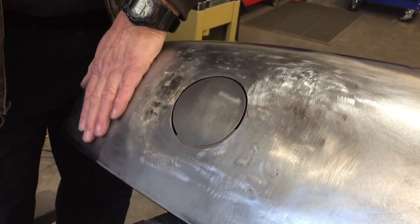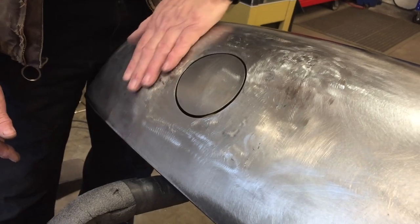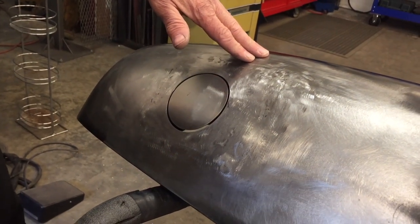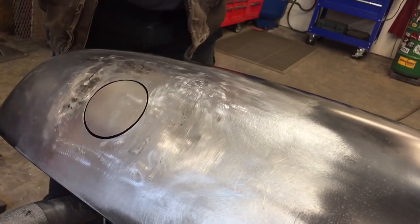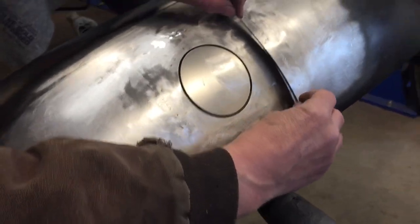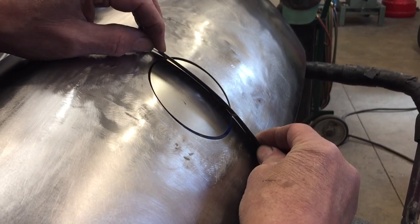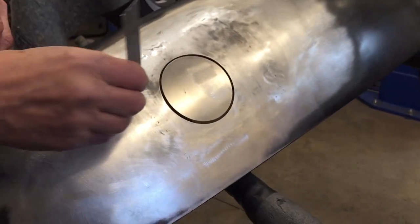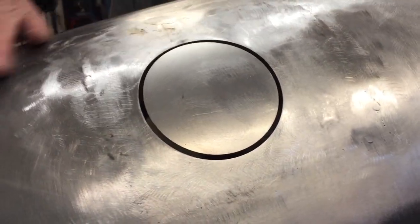And then it's amazing how accurate your hands are. You know, just feeling the shape of the fender, you can find the low spots. And then I use this little ruler here, and I just bend it at a little bit of an angle. I don't know if you come around here, you can show them, sweetheart. So I take it like this, and then I just move it along, and I can see the low spots, the high spots. Anyway, I use the ruler. I check for, you know, if it's flush at the seams, and then just a ton of hammering.